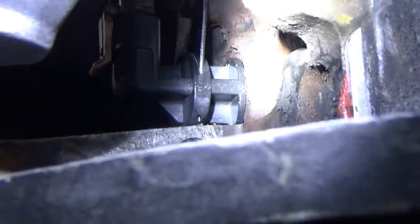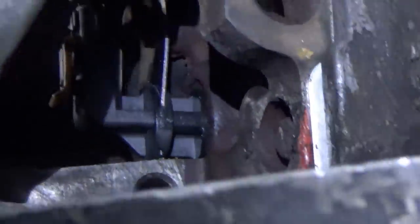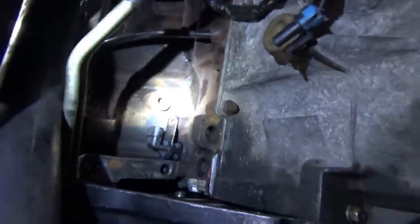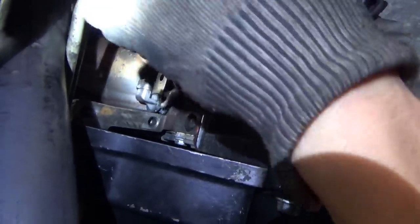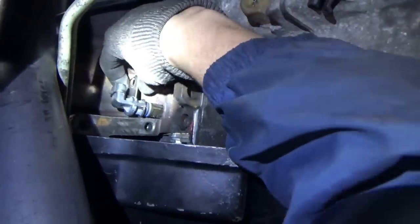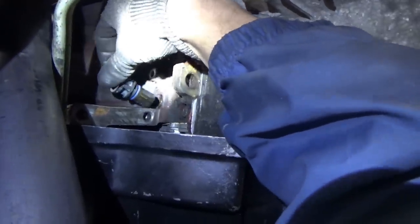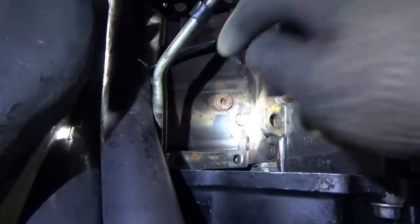Basically, in this case, I think the air gap is a little too big — the sensor's not inserted all the way in, that's the problem. We could just try forcing it in there, but I feel like doing it the right way. The bolt is out and it does say China on it, but it could be GM OEM because everything's made in China these days. Let's try to get this sucker out.